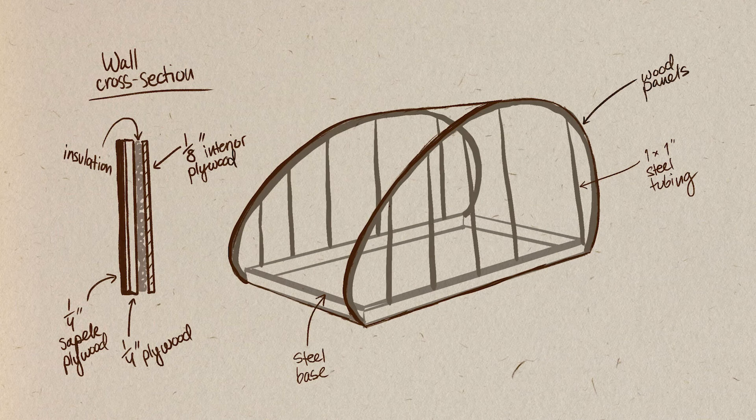Once we had a design that we were happy with, it was time to gather all the materials we needed. There are a lot of options out there for how you can go about building a teardrop trailer. Plenty of people do it out of wood solely, but we decided that we were going to do a metal frame with wood on the interior and exterior. The trailer base would of course be metal, but we decided to also build out a metal frame using one inch by one inch steel square tubing to give the sides the shape we were going for and also put in support beams along the side and the top. We bought our steel from a local steel supplier, which I would recommend if you're buying in bulk — it tends to be cheaper.